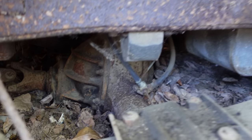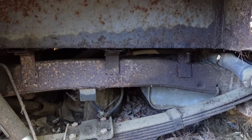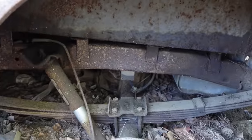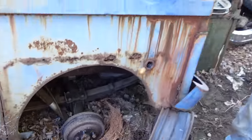We can see this is a body-on-frame vehicle — the frame rail right there, with the body bolted down to it. So it's light, but not as light as it might be. Notice the canted shock absorber arrangement to help tame axle hop and axle dive on acceleration and braking.